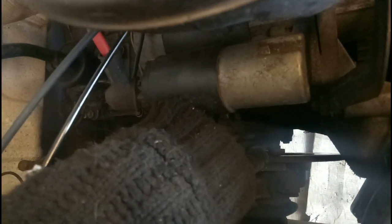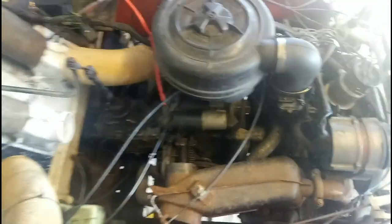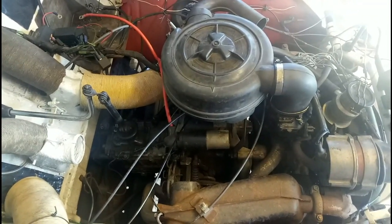It's separate handbrake pads for the 2CV. They're in this housing at the front, and the main brake pads are down here at the back. That clip is all that holds it in place. So you flick the clip out, remove the pad in seconds. Easy.